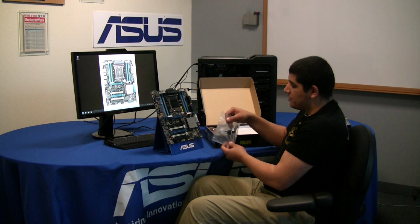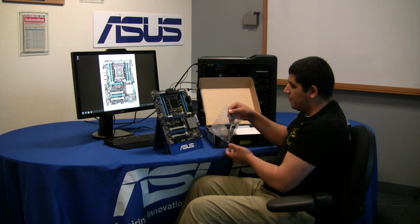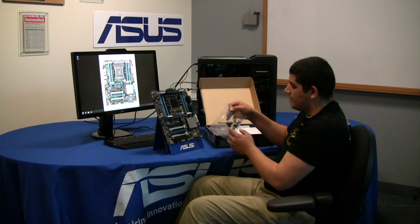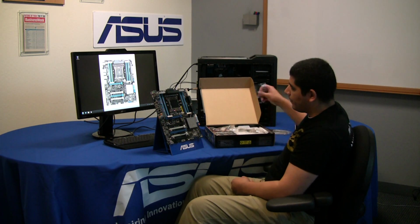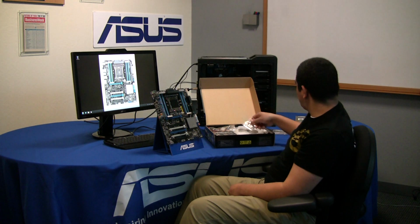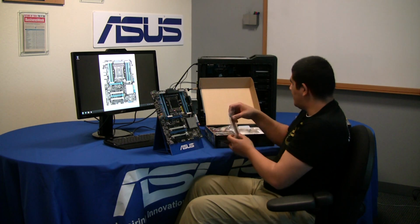For professional users that might still be using specialized devices, whether they're COM-based adapters, or maybe they're utilizing connections to serial-based printers or different types of devices like that, we have a COM header that goes to a serial port interface that would connect on the board. That comes included. We've got our Q connectors, one for the actual chassis power leads like power and reset, and then we've got the Q connector for USB. We have an extended SLI bridge for 2-way SLI support.